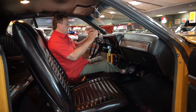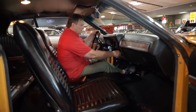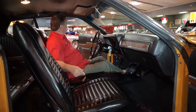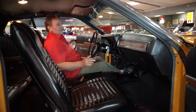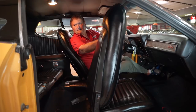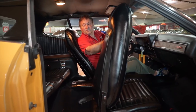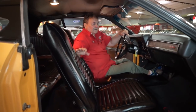Nice cluster on it — the faces are clean and clear. You've got a speedometer, fuel gauge, temp gauge, amp gauge, and oil pressure gauge. The original equipment radio is still intact in the vehicle. Wood grain everywhere — on the door panels and transitioning onto the dash piece, which is also set into wood the way it was in 1971 in a GTX. Roadrunners did not come with these amenities. GTX interior with the correct style vinyl — the correct type of vinyl. High back buckets in it that match the back, absolutely perfect. Side panels in the back are as nice as you'd ever want to find. Armrests and ash trays in the back — actually on the side of the panel. GTX is a little bit higher-end car than a Roadrunner, with a lot of different amenities.